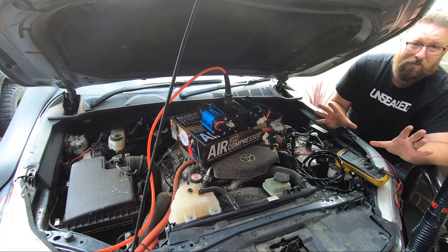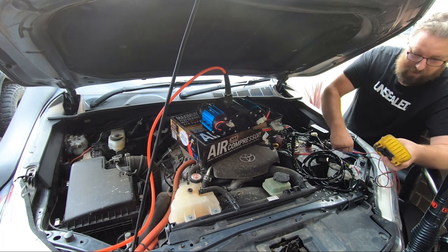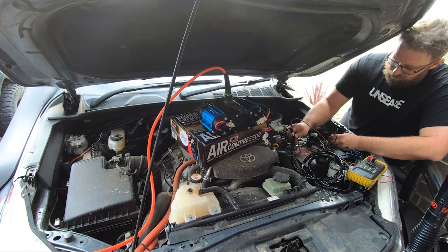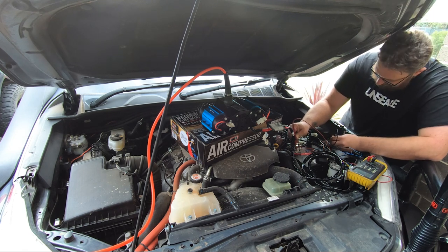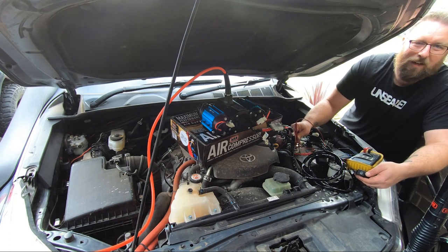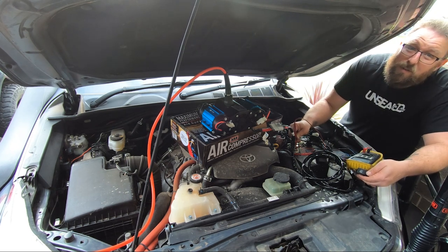Just to give you guys an indication, I'll start this - I've got it absolutely jury-rigged, it's got power, I'm taking the ignition source straight off the battery. At the moment I'm sitting on 12.6 volts. I came out last night, drove it yesterday afternoon, haven't driven it overnight or this morning, so sitting at 12.6 which means my battery's not having a great time - probably time for a new one anyway.